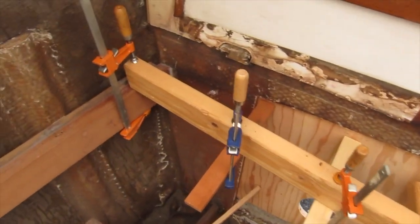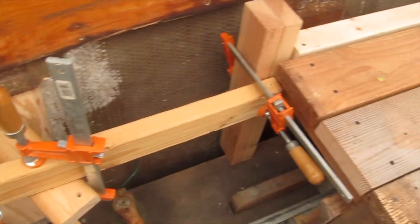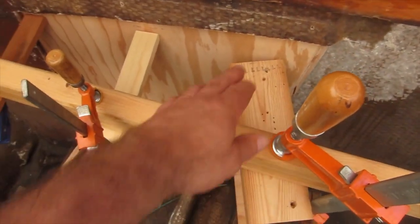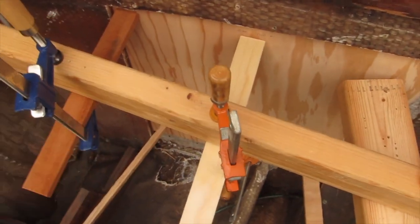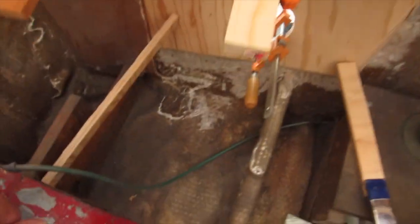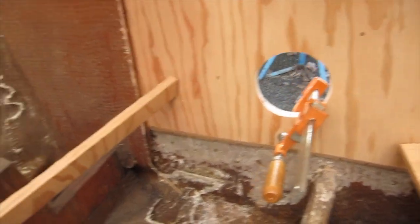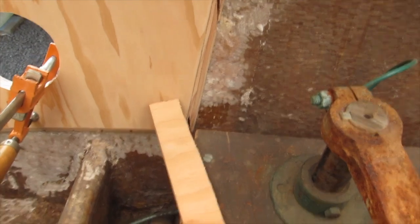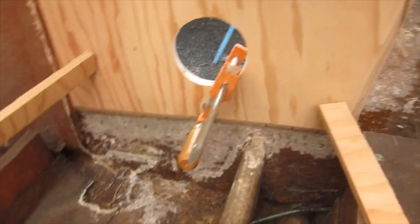I have a 2x4 clamped onto my ledger board there and onto the stair over here. Then I had a series of boards clamped to the 2x4, just pushing against it at certain points: three points on the top, and the same on the bottom. I had the clamp on the hole, and then this piece of plywood wedged in over here like a springboard, and one over here with just a little clamp holding it, since I didn't need much pressure over there. So that's it. That's how it's going to be